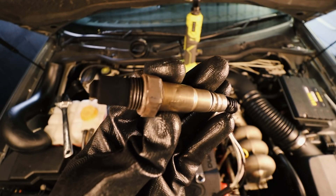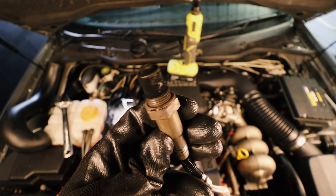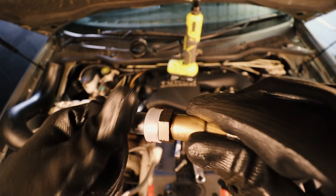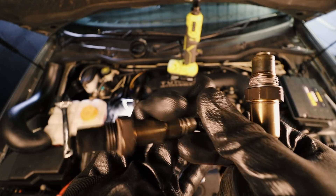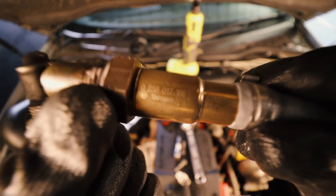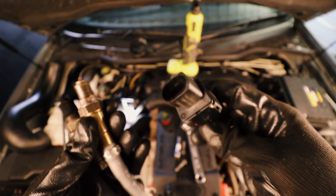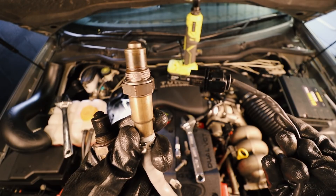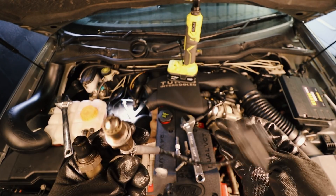Here's a look at our stock narrowband O2 sensor — it is looking a little bit sooty. This car was running a bit rich due to my own fault with misconfiguring my new 1000cc injectors. Here's a comparison to our brand new Bosch unit. From the outside it looks about the same. The narrowband one in my car doesn't seem to have a brand on it, so it's probably a no-name, whereas this one has the Bosch label and the part number. As mentioned, it has a different connector on the end, but it will splice into the wiring harness Haltech provided, which will then go back to our Haltech Pro plug-in. It should be as simple as screwing this thing in, running the wiring harness across, and the rest is Haltech ESP configuration.